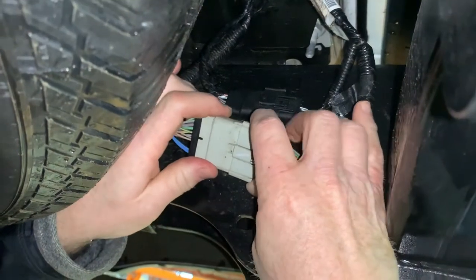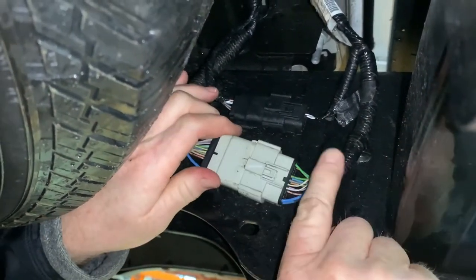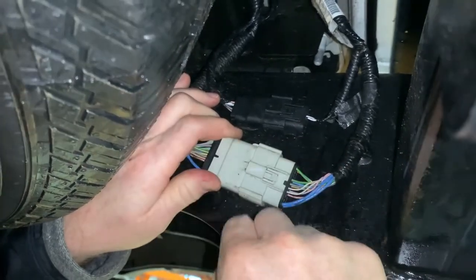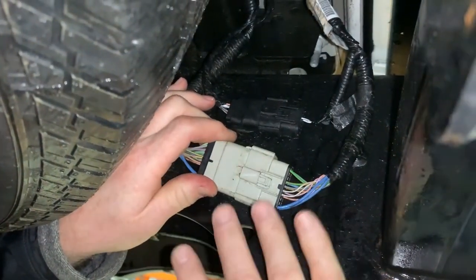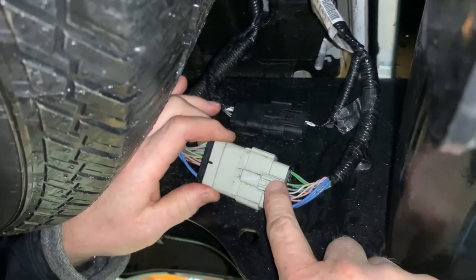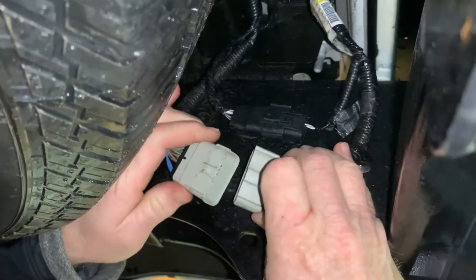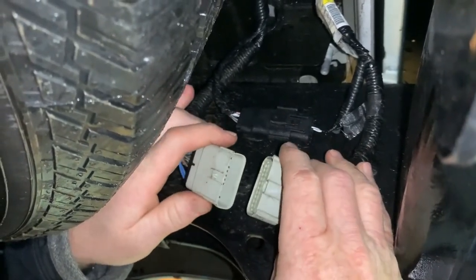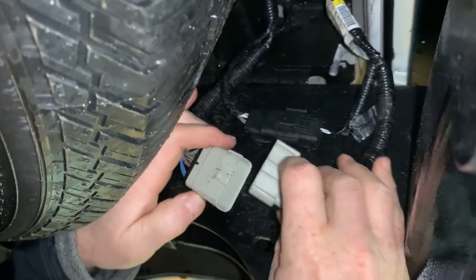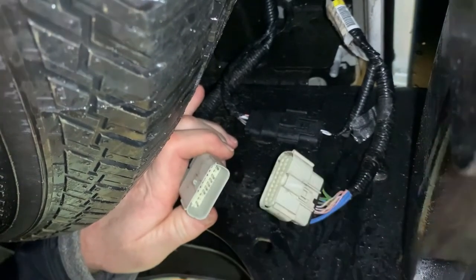This connector is on the truck's main wiring harness coming from the truck and splits down into the tailgate. It's between the spare tire and the passenger side of the frame rail — very easy to see when you get underneath the truck. It's just got a little detent lever on it. Push that down and give it a wiggle, then pull it apart. If your truck's got a few miles on it, there could be some dust in there and you might need a pair of pliers, but it's still very simple.